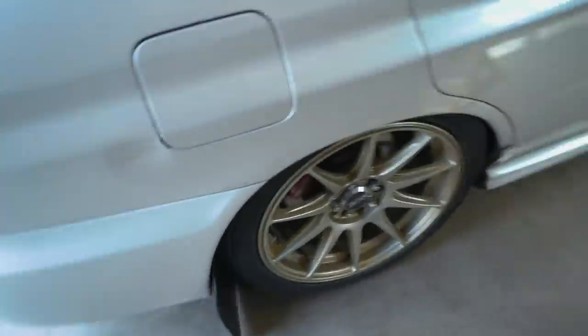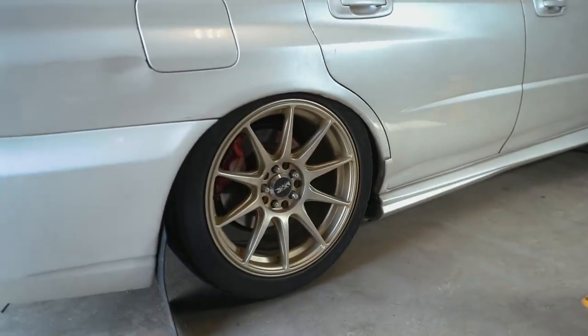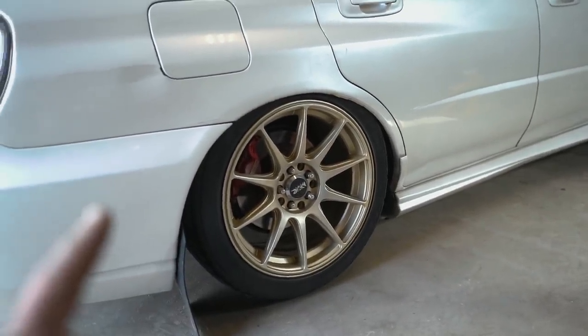The back is quite a bit lower than the front, so I'll probably go up like an inch in the rear. What we're doing up front is pulling the front half of the fender liner out — I'm actually cutting it right above this tab that runs across — and then we are lowering the strut a total of one inch.